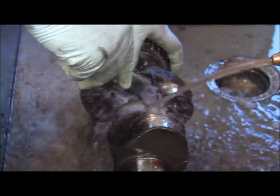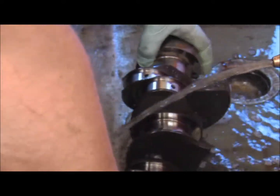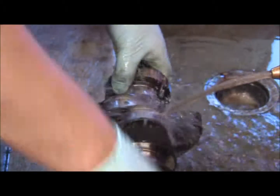Once the shaft is off the grinder, we do a finished wash, including brushing all oil passages, tag it, and bag it in our clean assembly room. Thank you for taking the Weaver Auto Parts Machine Shop Tour today.